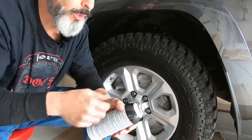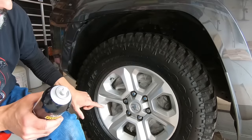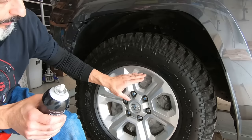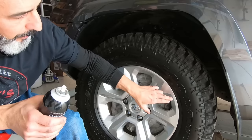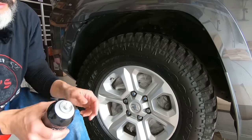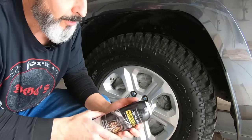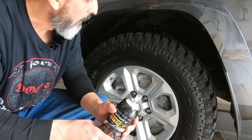All right, I have all four wheels prepped. Dip release is on. I did the pre-dip spray or cleaner, and I made sure that where the wheel and the rubber touch, it's completely clean. Plastic's behind, protecting the calipers and the rotors. And I'm gonna start my first coat.